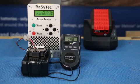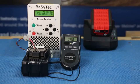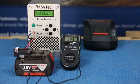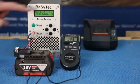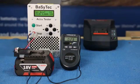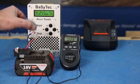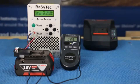And don't forget, drills use a very high current when they're driving auger bits and hole saws. 12 amps is actually quite gentle, so that temperature could easily go over 60 degrees in normal circumstances. Okay, same test now, 10 minutes at a steady 12 amps discharge. We've got the temperature probe in place now in the new Bosch 18-volt CoolPack. We'll set that going, set the timer. See you in 10 minutes.